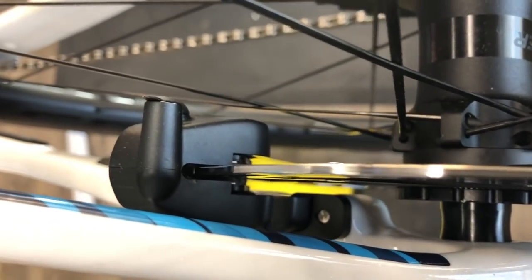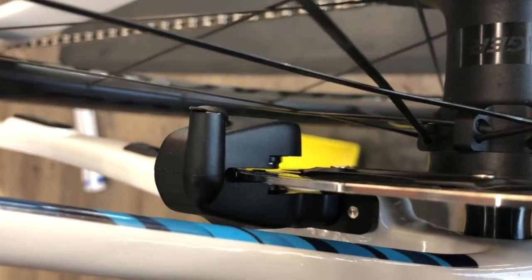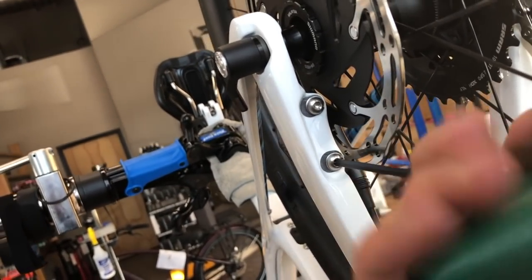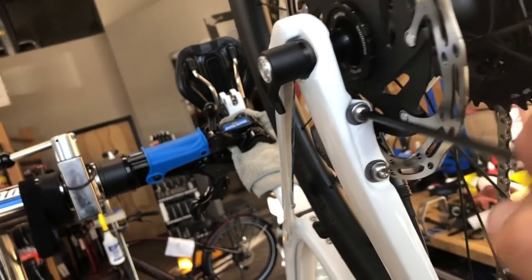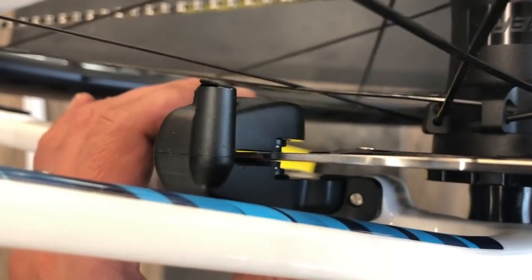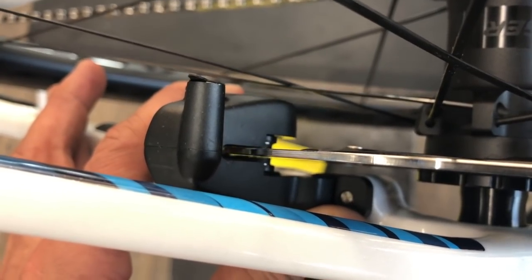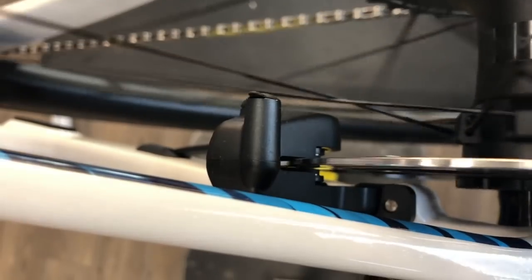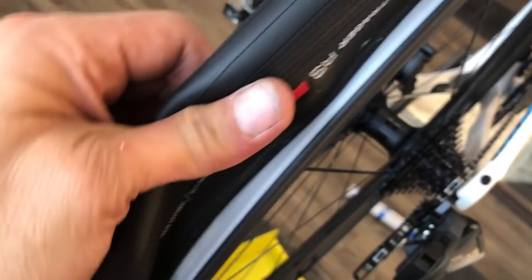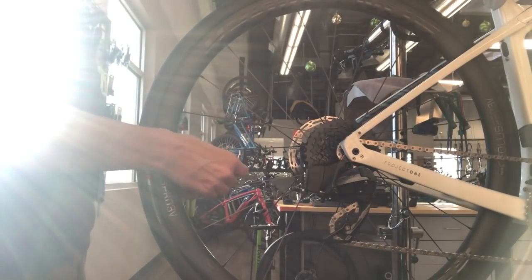Going to adjust the caliper. I've got a high-vis background so you can see it — the caliper is pushed pretty far to the right. Flat mount brakes are pretty easy to adjust for centering. Just break these two T25 Torx bolts loose, then line it up using the high-vis background. You want to see equal yellow — or whatever background color — on both sides. Your eyes see it from a couple of dimensions while the camera only sees one. Got that dialed in and cinched down.